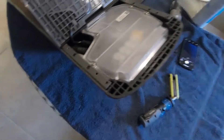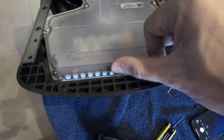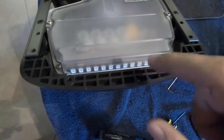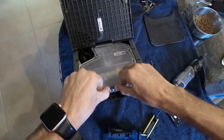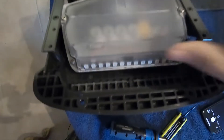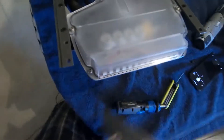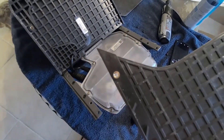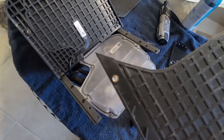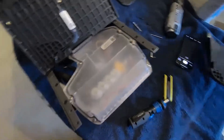You can remove those two little screws and now you have an easy grippy thing here. Take your thumbs in the middle and your fingers on the bumper — use the combination of thumb push and finger pull and it comes right out. Look at those nice inserts there. Now that you have those inserts, if you screw up your threads — cross-thread or strip them — just replace the bumper. It's a nice replaceable part rather than having to do helicoils and all that.